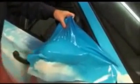When applying vinyls to an outside mirror, a vinyl should be cut with some margin remaining, the protective paper removed, the vinyl placed on the mirror and heated in large sections. Then, the vinyl is pulled with some tension and firmly applied with a squeegee. This operation is repeated several times until the mirror is completely wrapped.